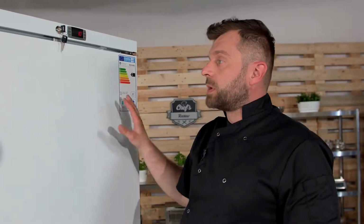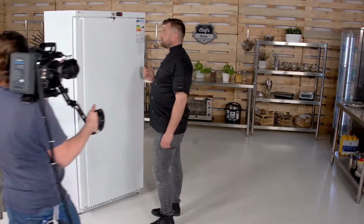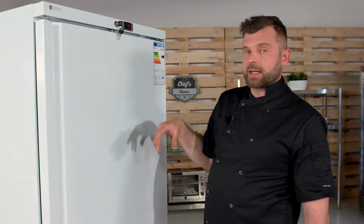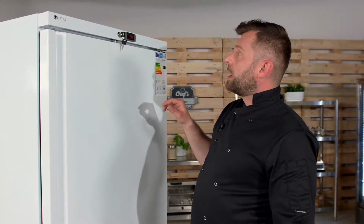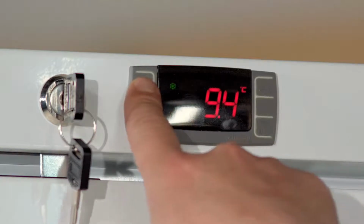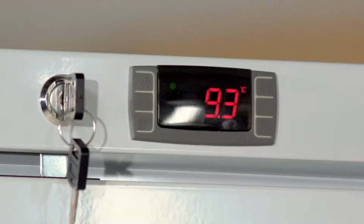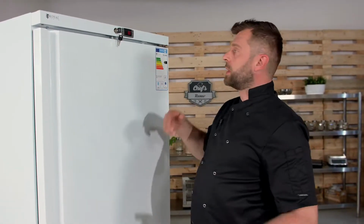But back to when you leave your door open. Well, this particular model is designed to defrost every 4 hours. That's the defrosting cycle. It will turn off the fan inside and it will turn off the chilling unit, so all the ice buildup will simply melt and go down into the drain. If there is a necessity to do it manually, you can do so by pressing the defrost button for 10 seconds. The defrost button is in the upper left corner on the display, and this will automatically cancel and reset the defrosting cycle, so it will defrost 4 hours from the time you push the button.